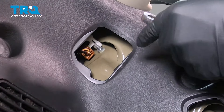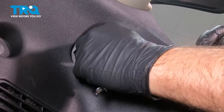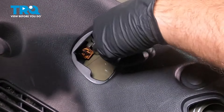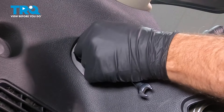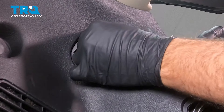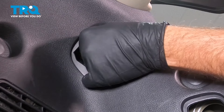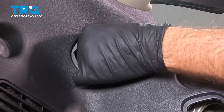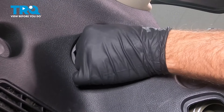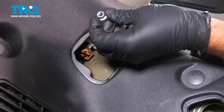That's the one we want to get to. In this case here, I'm going to use my gear wrench and pop that up inside. It's because of the angle that we can't really use that socket and extension in there, but it's not that big of a deal — there's plenty of room to get some fingers in there and operate that. So go ahead and spin that nut off the rest of the way. Don't work too fast; you don't want to drop that nut down inside this panel. Work that off, and there is that other nut.